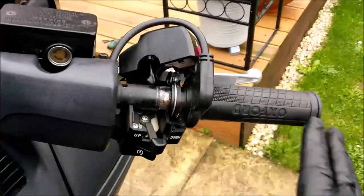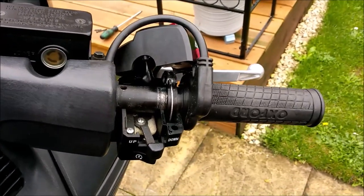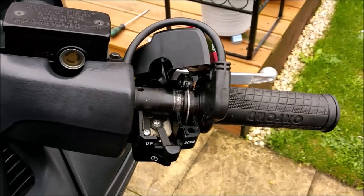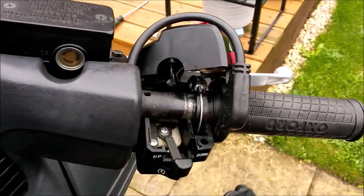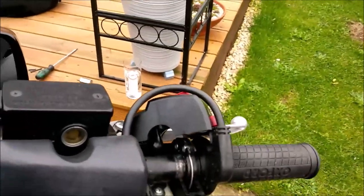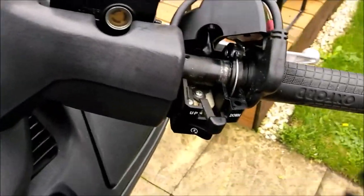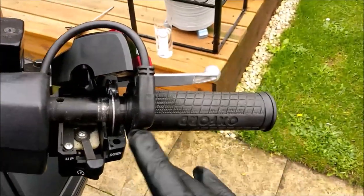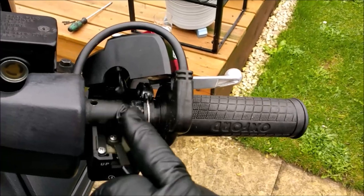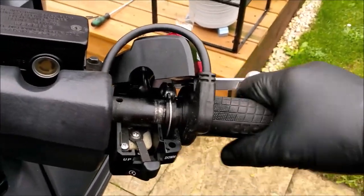Guys, when you're doing anything like this to a moving part, unless it's like brake pads and discs and tyres and stuff, lube it, please. A little bit of copper slip on bolts, a little bit of 3-in-1 oil or general all-purpose lubricant, you know, this, that and the other for various parts of the bike. But certainly for grips, pop a bit of grease on the metal, on the handlebars, and get your finger in there, wipe it around the inside of the tube, and then slide it on.